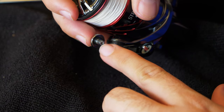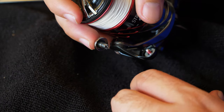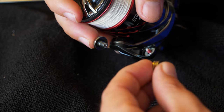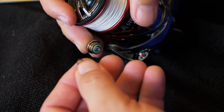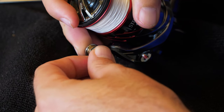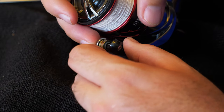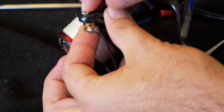This actually can come out completely and you'll see there's a little gasket and also this little ring here. I personally don't remove those - just keep your finger on the back of it. I'm going to quickly swap out the new bearing. All I do is slide the new bearing on here. You're going to notice this little black piece - see how that fell out? That goes on this side. Make sure that doesn't fall out, then swing the arm back up and align everything.